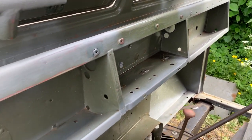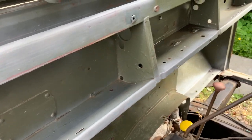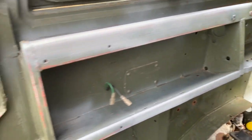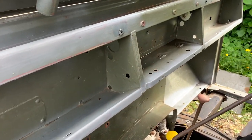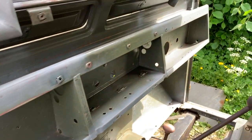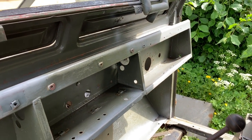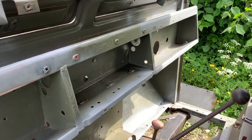and I'm just giving it a little bit of a spray with some primer, not etch primer, you don't need etch primer because this is metal, it's not actually aluminium, so just an ordinary primer on any bare metal that I did expose so that it doesn't flash rust overnight or rust at all. Next stage will be to just give it another light sanding with maybe the 600 again, and then do the top coat with the deep bronze green.